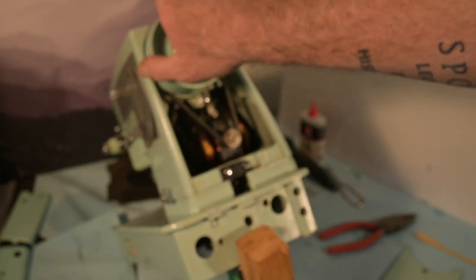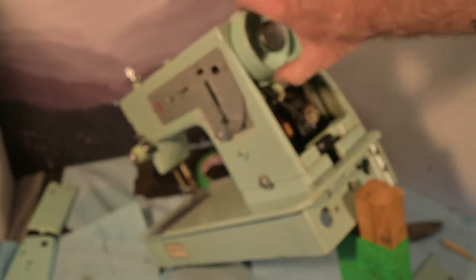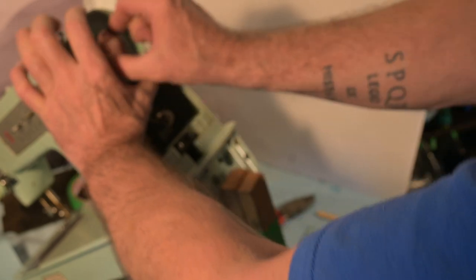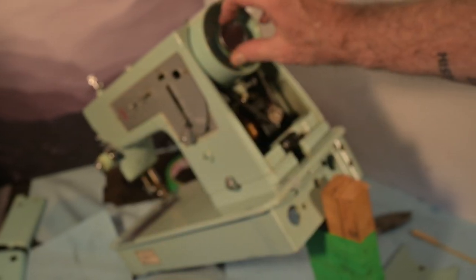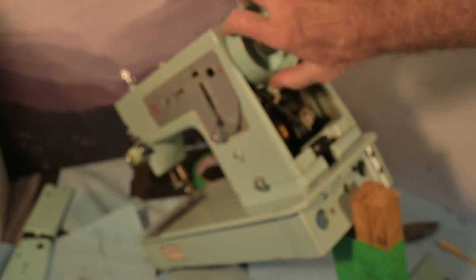So there we have power — can you see that? The needle bar is moving. There you can see it's moving — that's with it in the engaged position. Now I'm going to turn it to a somewhat loose position. When you look at the needle bar now, it's stationary — that's for the bobbin winder. Then if I move it back to the right — righty-tighty — then we have action on the needle bar and the horizontal arm shaft. That's our test. Done correctly.